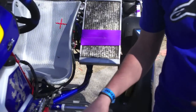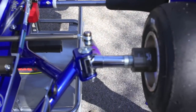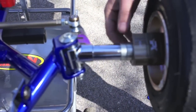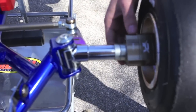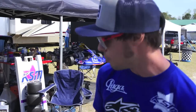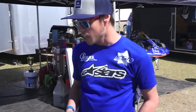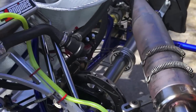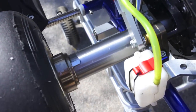The front end is actually neutral — this is how the Praga chassis comes out of the box. We're running 20mm of spacing with stock 95mm IPK hubs. Moving to the rear of the kart, same thing: standard axle, standard 95mm 3mm hubs that come on the Praga kart out of the box.